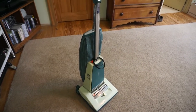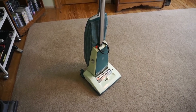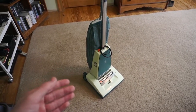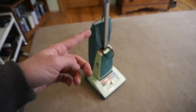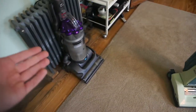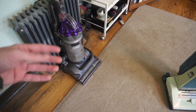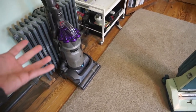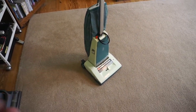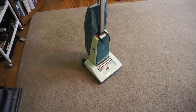This vacuum is unlike modern vacuums in one massive way right off the bat. This is what you'd call a direct air or dirty air vacuum. What that means is dirt is picked up down here where the cleaner head is and is transferred up a pipe and sucked directly through a spinning fan, where it is broken up and ejected upwards into a filter bag. Unlike most modern vacuum cleaners which use what they call a bypass design — like this Dyson — where dirt is picked up from the cleaner head, brought up into some kind of filtration device, be it a bag or a cyclone separator, and then mostly clean air is sucked through the motor and through a filter. One thing about the direct air system that everyone seems to like is there are relatively few bends and hangups for the air to get slowed down on, meaning the vacuums work very well.